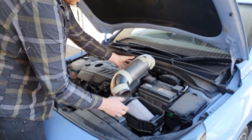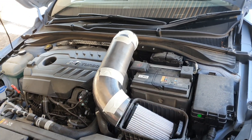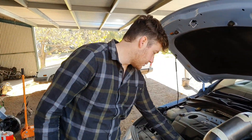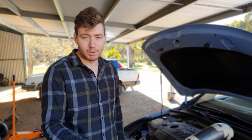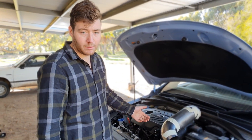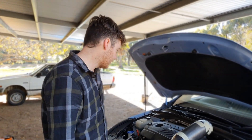As you can see that's going to sit like that - it won't really sit up that high once I pull all the other stuff off and remove the intake and airbox. About that blow-off pipe: everyone in the i30N world runs a dose plate, which is a plate that goes between the intercooler piping and the blow-off valve so it can't actually blow off any air. I'm not putting that pipe back because it doesn't get used anyway and it's an eyesore. There's also a Turbosmart blow-off valve on it, but it doesn't work since I've made a dose plate.